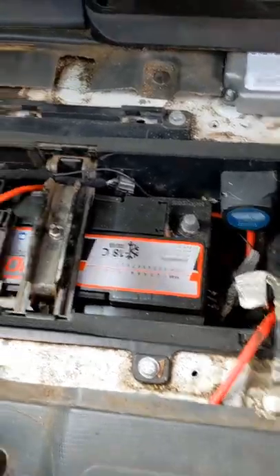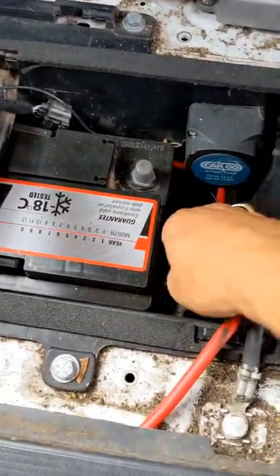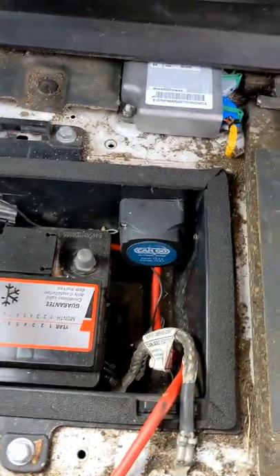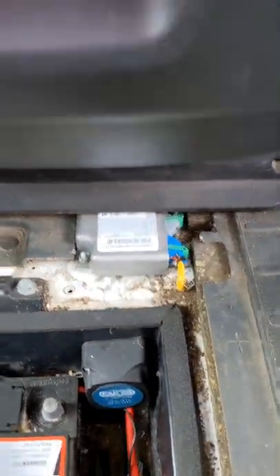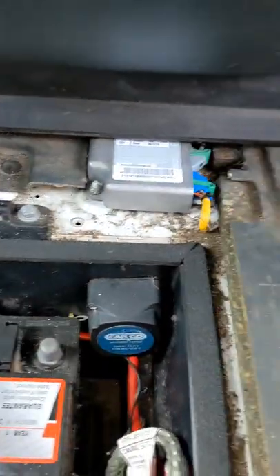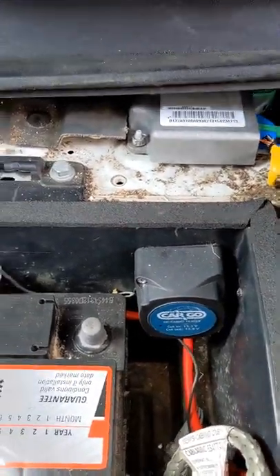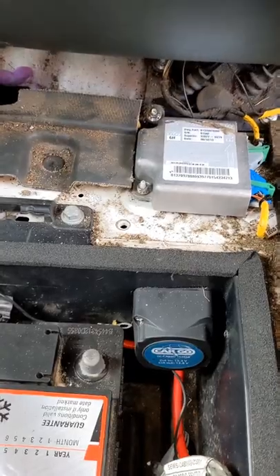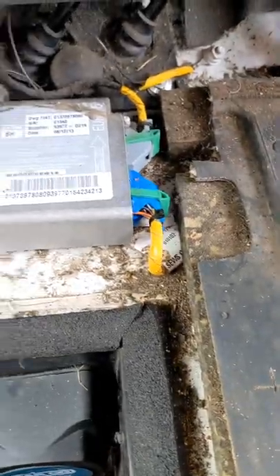This earth must be disconnected straight away — very, very important that you take off the earth. This is the little bugger that needs to get changed. There are screws on all the models; mine came off with the Torx. That panel just slips out and exposes the ECU. As you can see, it's quite dirty.